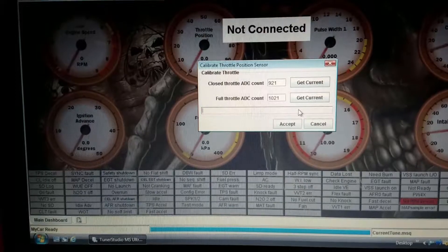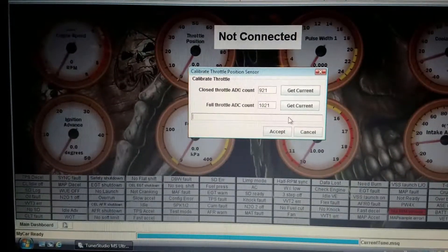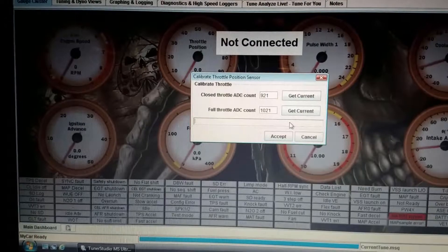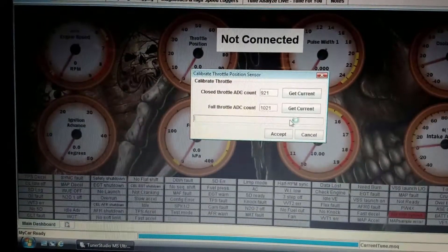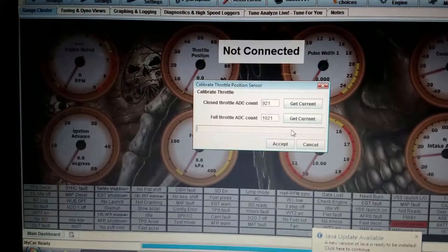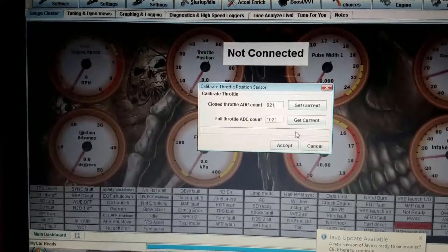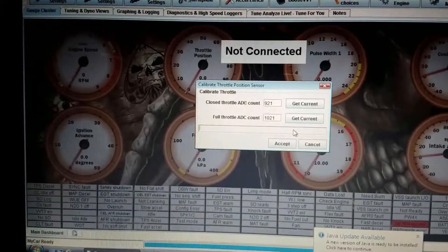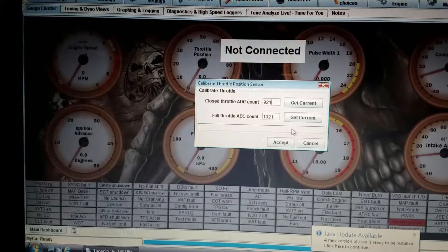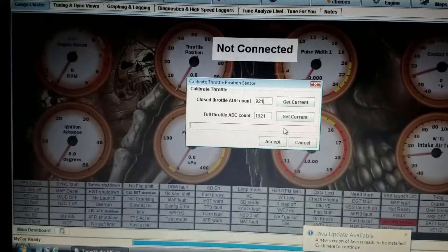What's actually happening is that when I'm at about a quarter-way open throttle, I'm at 100% throttle position. So what I believe is going on is that the sensor in relation to the throttle body definitely needs a little bit of adjustment. I want zero percent to be when the throttle is totally closed, so we don't have such a large number spread, and when I put my foot to the floor the sensor actually reads the appropriate number.